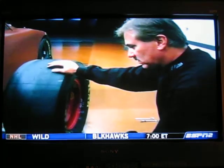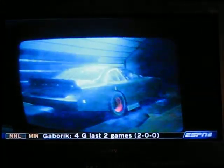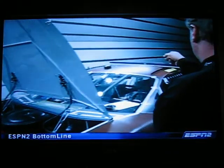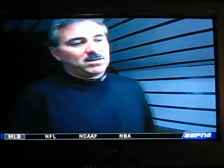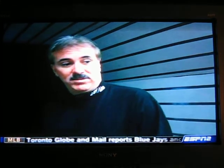It's got two eights here, it's got a quarter inch. It doesn't have enough of what we call coke in the side of it, which is where the side comes in and the backside kicks out. It doesn't have enough of that in the rocker panel, so that was definitely not a setup deal — that was on the plate. They didn't quite get the measurement right on it.